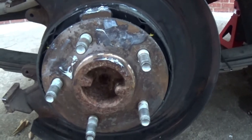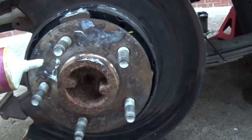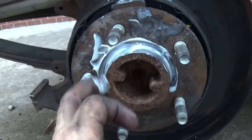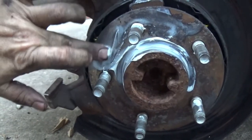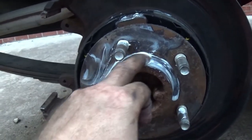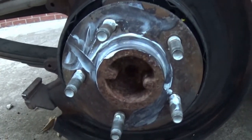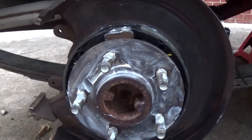So we'll do the setting of the e-brake stuff from the end later on. Here's a little pro tip — get some lithium grease and smear it on there and all around through here. It's a little bit overkill, but you get the point. Cover that right there, because what that's gonna do is prevent your rotor hat from ever seizing up on the axle here and make life a lot easier on you later on.